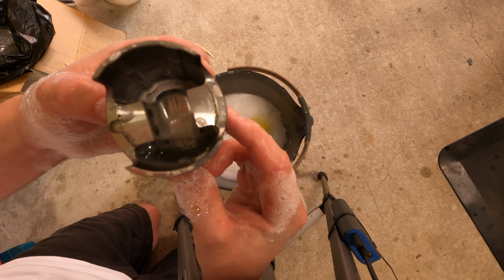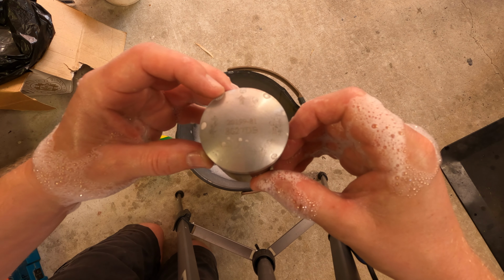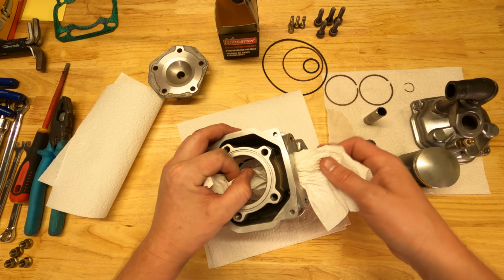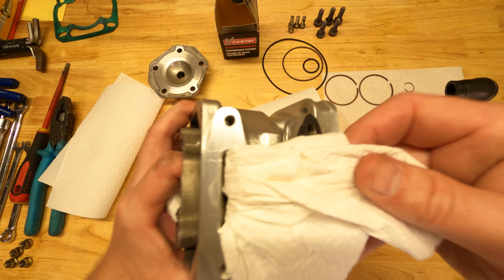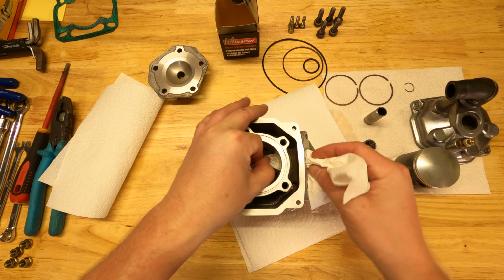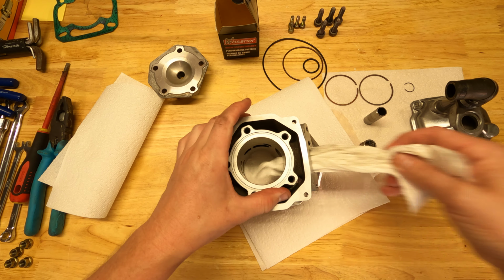Before any headwork was done, the top end rebuild took the compression from around 90 psi to 100 psi, and the piston squish remained the same at around 1.7. My top end rebuild series shows this. I was not satisfied with the marginal gains, and as I'm chasing a bit more performance, I decided to improve the piston squish on the engine. So here's how I did it. The internet forum suggests the piston squish of around 0.8 millimeters is optimal for performance on these engines. However, I'm seeking a good balance between performance and reliability without pushing too hard and risking sacrificing reliability.